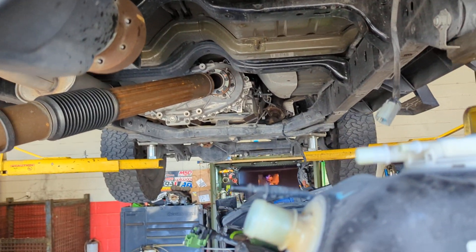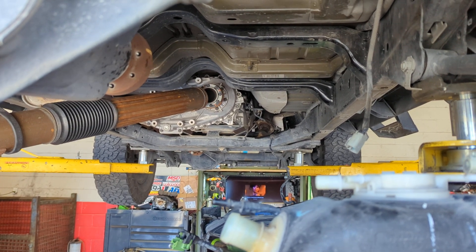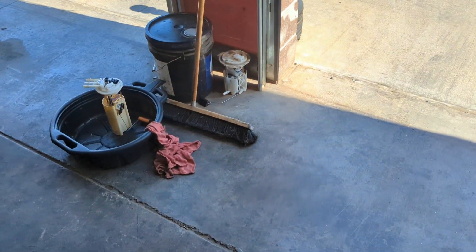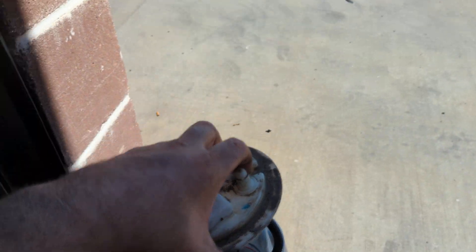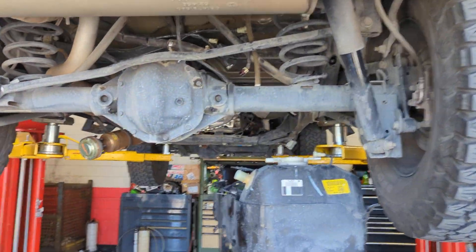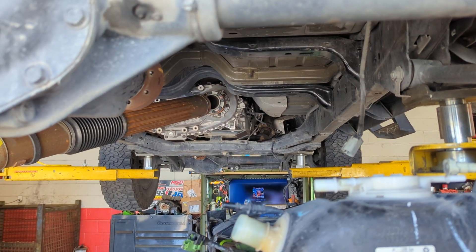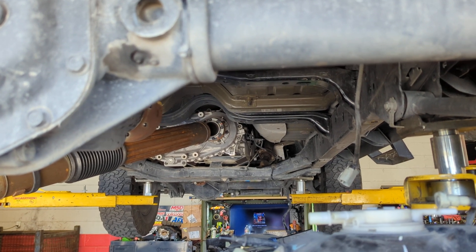Just waiting for my fuel pump and I'll put it back together. It's pretty simple. This one had an extended crank. What it was doing is it was leaking out the valve — that's what a Camaro one I did the other day had too. It was leaking out the valve so sometimes it would bleed down. When it bled down it was an extended crank. It showed good fuel pressure, but then it would bleed down and not be primed. Without it being primed, it would crank and crank until it got that prime again.